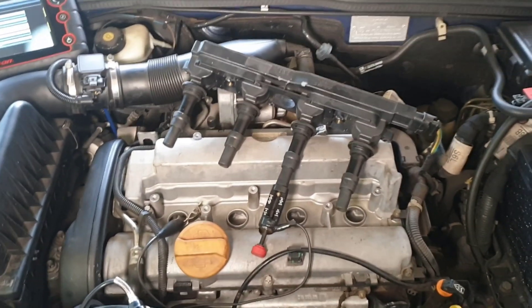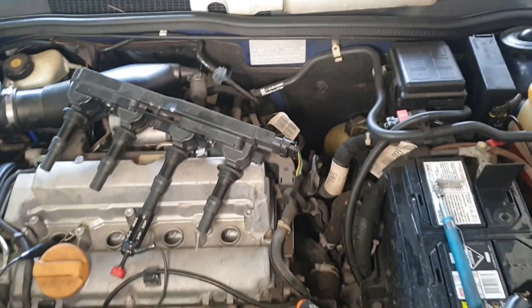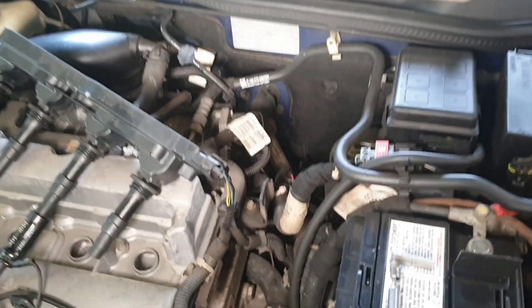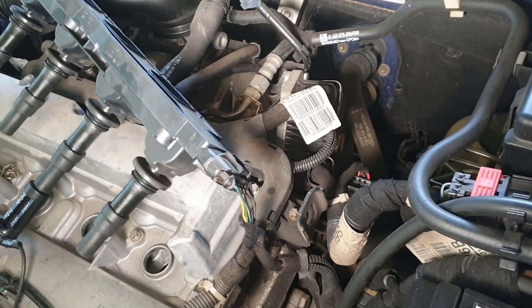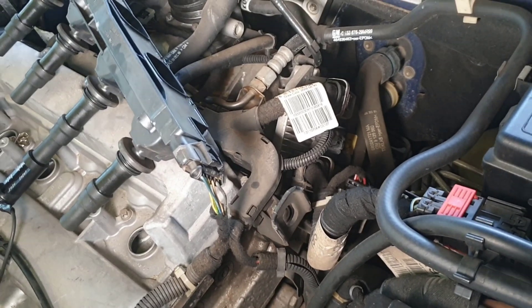got a misfire cylinder 3 code, went for a drive, drove fine. So I let it sit in the corner with an accelerator pedal tool on there to raise the RPM with the bonnet down, got it nice and hot, went for a drive and eventually I did get some misfires under load. I had a dead misfire at that point which I wanted to see if we finally had a dead fault or if the injector probably got disabled when it set the code.